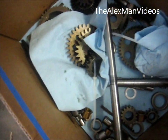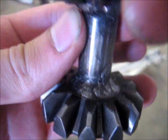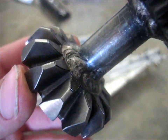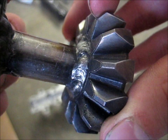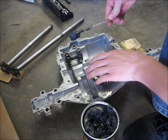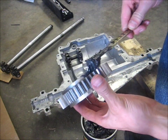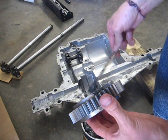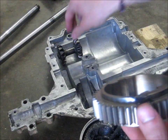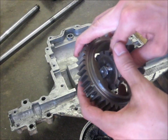Once you have all your parts cleaned you're ready to start assembling the transmission again. You can see the actual weld that's going to hold the torque of the axle - that's the part that's actually holding the differential from turning. Don't be afraid to use large amounts of grease on the machined surfaces right here where the actual differential is going to be riding. Let's go ahead and spread some grease in there. Then you can install the main part of the differential here.